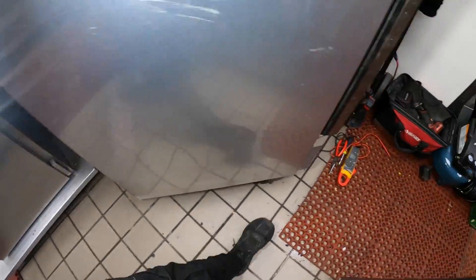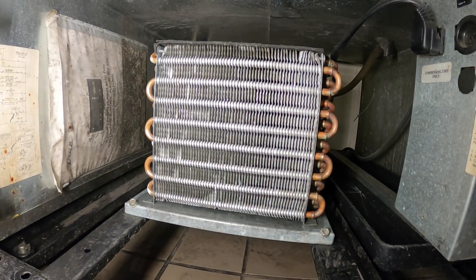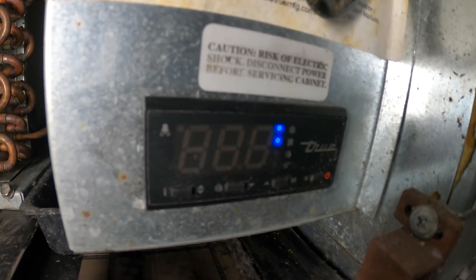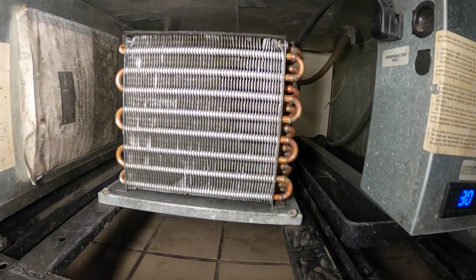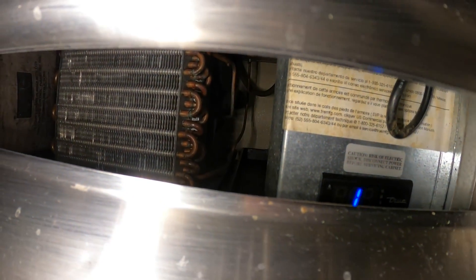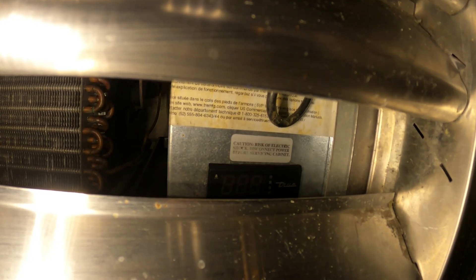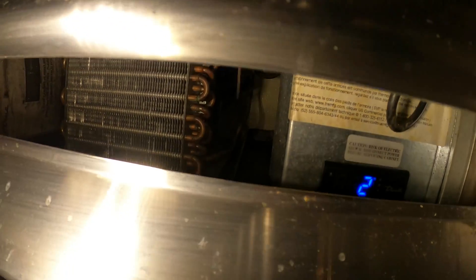Let's push this thing back in. I just plugged it in — it's showing 32 degrees in this box. The compressor started right up and we already dropped a degree. Let's give this thing a chance to run. It's not so easy to reach zero degrees, but we just dropped another degree — that's a good sign. It is all wrapped up. The box temperature is now at 13 degrees. I'm going to give this unit a pass at this point. I couldn't even see any light through that coil — it was completely packed, the compressor was very hot, and in my opinion we were probably going off on thermal overload. For the fact that they said it runs then stops, runs and stops, and that coil was in that condition — I'm definitely going to say that was the issue.